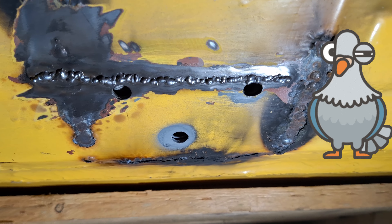That'll be ready for primer and that's another one down with one to go. This is what I'm left with — I think it looks really good. I just sort of filled in the pin holes with weld, give it another clean up on any that you miss, fill them back in. I think it's worth the extra effort because it looks really smart, and that's without any seam sealer or anything. Going to put some zinc primer on it now — let me know what you think in the comments.